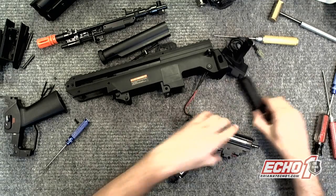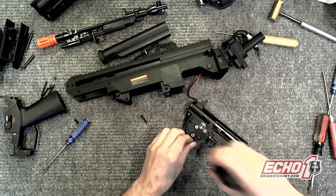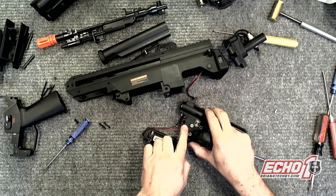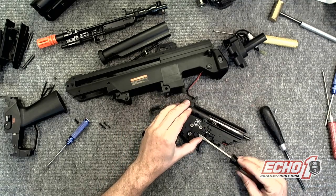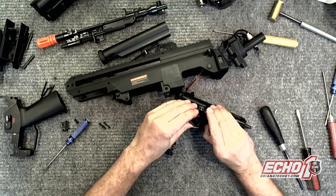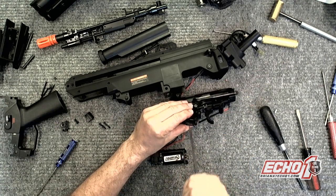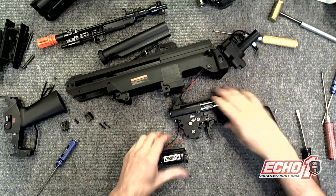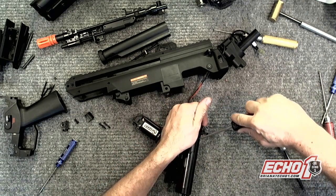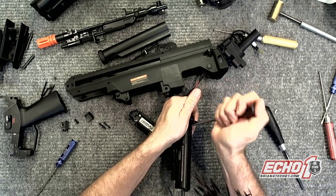The gears are good. Just taking off the motor. To remove this little part, I just pressed and the little hook right here came off. Same with this one, just kind of pop it up with the screwdriver — a little clip. And then don't forget the little plate on the top. For this you can just pry. Be careful — you don't want to stab yourself. Kind of ruin your afternoon.